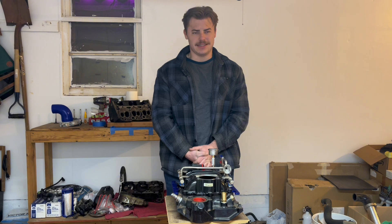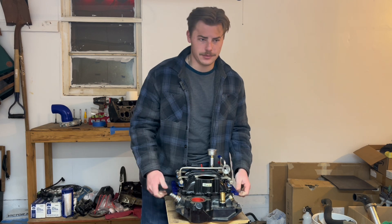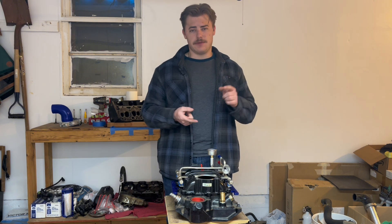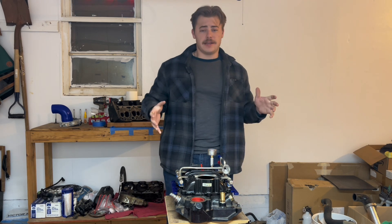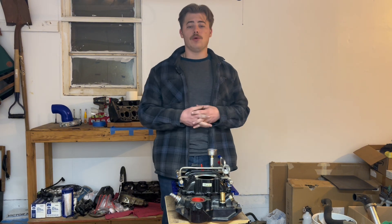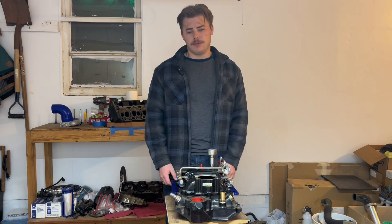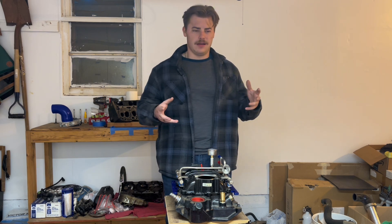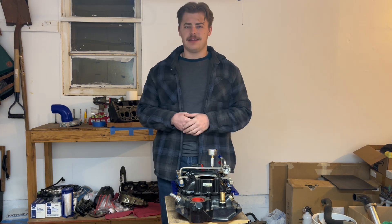In conclusion, yes it's really heavy — about 60 pounds, it is cast iron, so don't drop it. But this switches to a better injection system, it's going to give you better fuel economy, and it gives you a lot more freedom if you're going to use power adders like a turbo or a centrifugal supercharger. I hope you found this somewhat informative, either teaching you about this or giving you better information on why you should do the swap. Thank you for watching — please subscribe and like if you'd like more of this. If you have any critiques, leave them in the comments, don't be a dick about it, and have a good rest of your day.